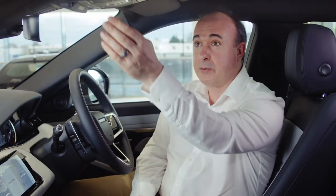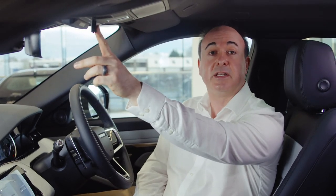To make the most of the advanced connectivity features offered by Evoque you'll need an InControl account. If you don't already have one you can create one at www.landroverincontrol.com/owner. To add the car to your account it'll need to be parked close by in an area with good signal. When prompted, add the Evoque to your account by pressing and holding the roadside assistance button located in the overhead console until the light flashes at a slower rate. This should take around 10 seconds and you have 60 minutes to complete this step. Then return to the website and follow instructions to complete the registration.